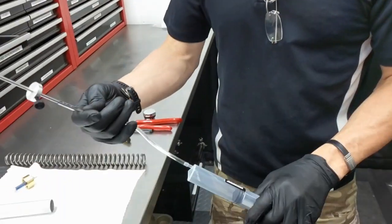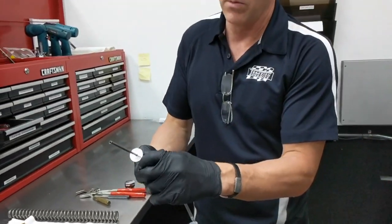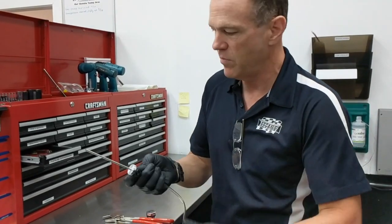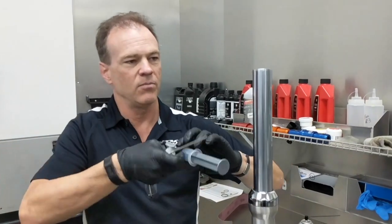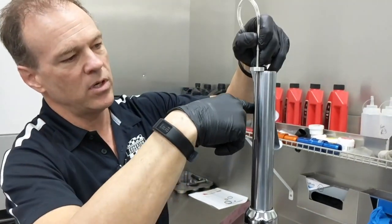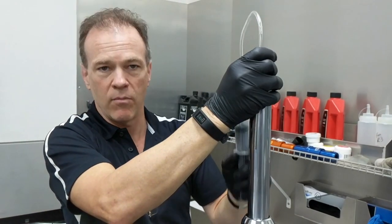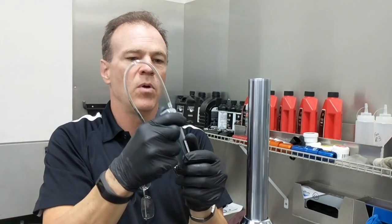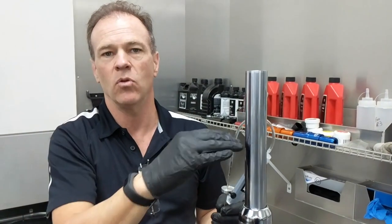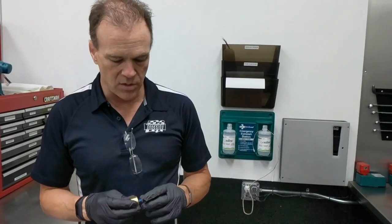This can be used on a multitude of motorcycles — you'll set your prescribed depth or oil level and that's all there is to it. You'll want the fork slightly overfilled so that when you put your tool in, the tool is below the oil. That way you want to make sure you suck on something — if you pull on the tool and you just suck air, you don't have enough oil in the fork to set the level; the level's too low. Then we can drop the little valve in.